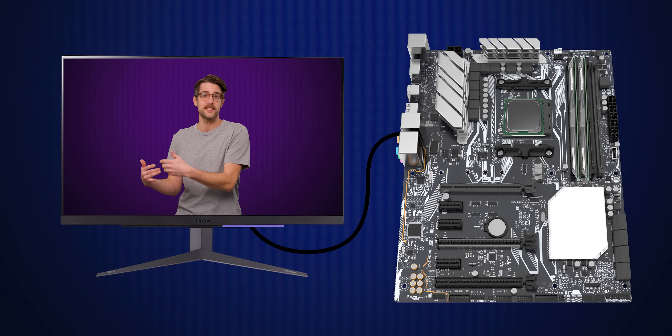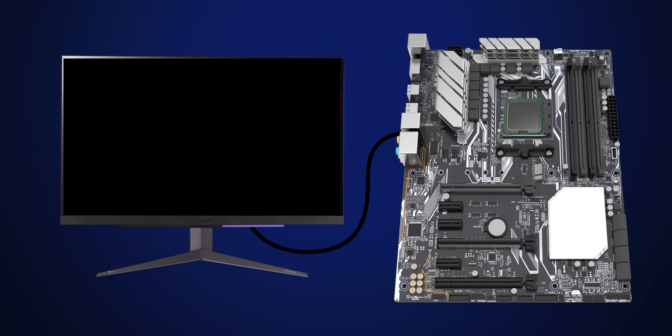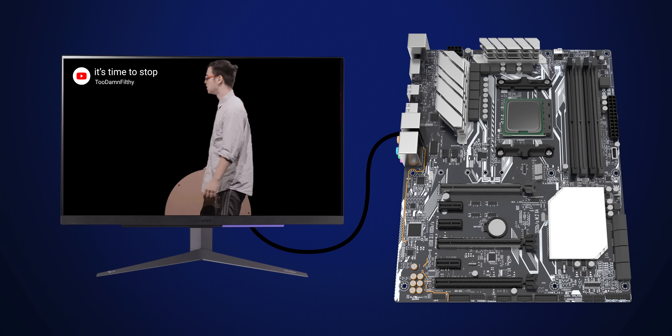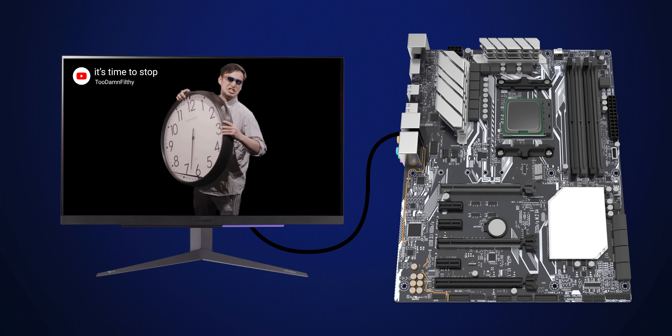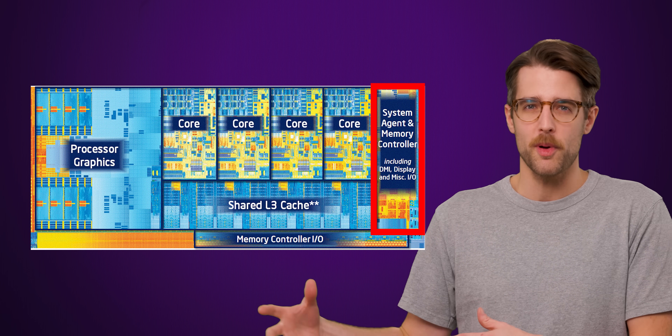The technical cause of this freezing is slightly different depending on RAM generation. If you're using newer DDR5 memory, the system can tell something has gone catastrophically wrong and just stop itself from trying to continue to execute any programs. Previous standards like DDR4 don't have the same kind of error detection. If you remove a stick of DDR4, the memory controller on the CPU won't get a response when it tries to send a signal to RAM, meaning the CPU will end up not knowing what to do next.